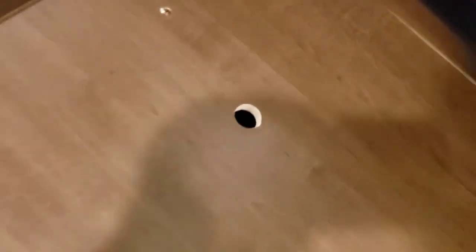Both lights above the bed click on and off. There's a vent here — no fan, but just a vent. Your bed does lift up and there's storage underneath. Importantly, that's where the fresh tank drain is. You want to drain your fresh tank after every trip. Lift up your bed, and there are two number-two square screws. Almost every fastener on this camper is a number-two square bit, so get yourself one. Unscrew both, lift up the panel, and there's a big red valve in there to drain your fresh tank. You don't want it sitting half full while stored because it'll start to get stagnant.